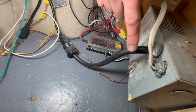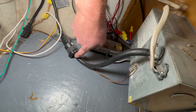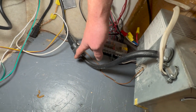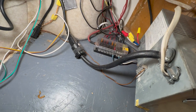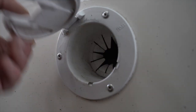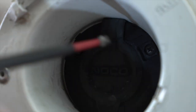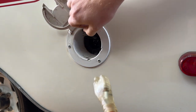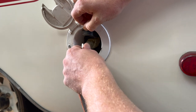Really quickly, the AC system: this used to run to a shore power cable that was about 20 feet long, so it would take up a lot of area. I cut it short, added a regular outlet to it, and then bought this extension which fit perfectly in the entry gland for the shore power cable, and screwed that in place — it just basically plugs in here. So now you just take a regular extension cable and plug it in here, and it'll power all your AC outlets.